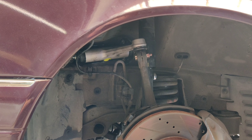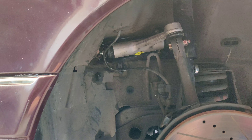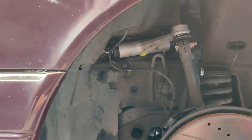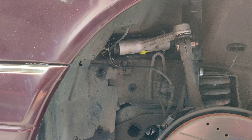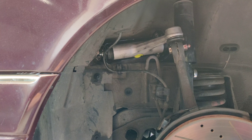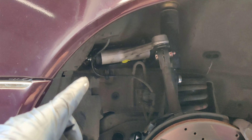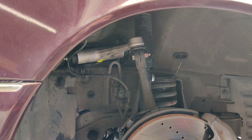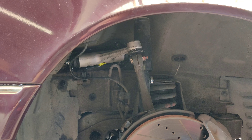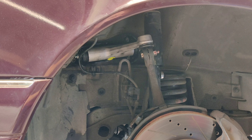One subscriber, Zach, mentioned that these allen key bolts need to be replaced. I highly suggest you do that — ECS Tuning has them for $9 a piece, and I'll link that. I did talk to other subscribers and found forums where people reuse the originals with lots of loctite, but for safety reasons I highly suggest changing them out. I'm going to test these since I don't drive this car much — I'll check at 100 miles, then 500 miles, and swap them out if there are any issues.